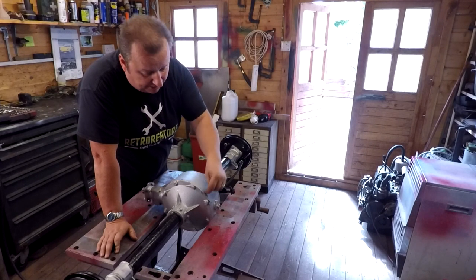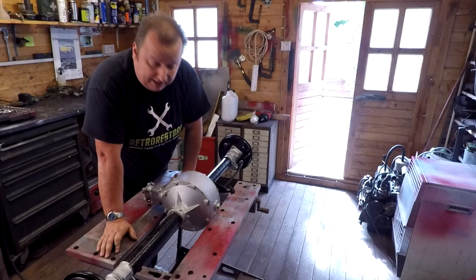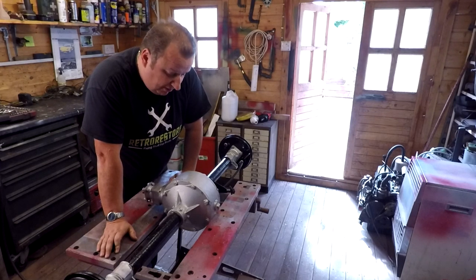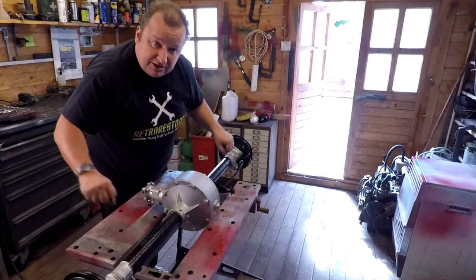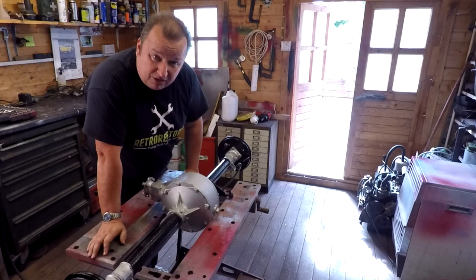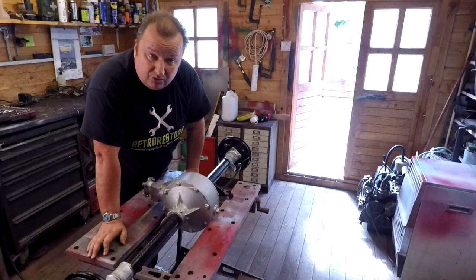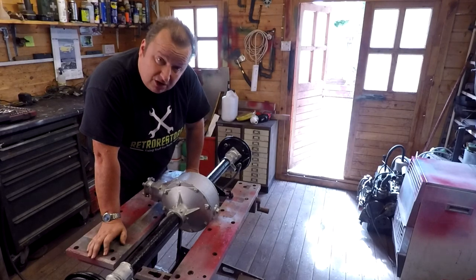Unfortunately I'm going to have to drain the axle oil out and change these paper seals, which I probably won't be able to get hold of and will probably have to make. So I'm going to start off by draining the axle, then unbolt all the bolts around it, separate it, make a copy of the paper gasket, and hopefully solve the problem. I'm going to turn this over and make a start.